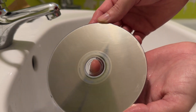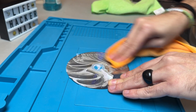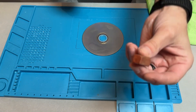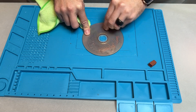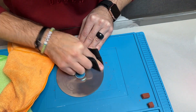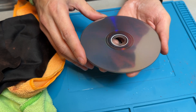The logic here is to take out the deep scratches, but I will get lots and lots of little scratches instead — little scratches that should be easier to get polished. So I started polishing the disc again with toothpaste. By this time I noticed something was wrong and figured out about the protective layer that I had partially sanded off. Then I started trying anything I could think of that I had around the house. I tried some polishing compound from my Dremel, and I tried changing the microfiber towel to a glasses cleaning cloth. I got some good results with this compound but not near the mirror finish the disc needs in order to work properly.